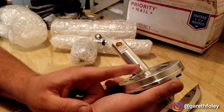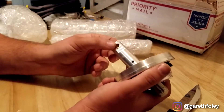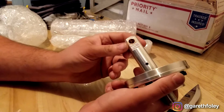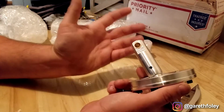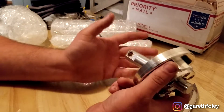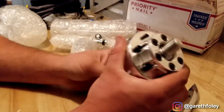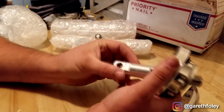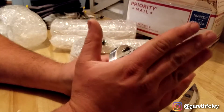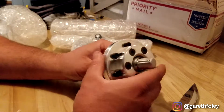There's a set screw here — I don't know the size yet, could be standard or metric. It does allow for some adjustment underneath the car to either shorten or lengthen the throw. Since I'm going with the long shift lever, I'd want this underneath to be as short as possible, compensating for the overall throw length with the length of the shifter itself.